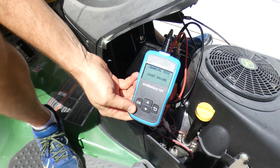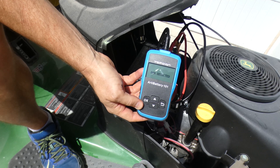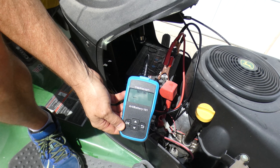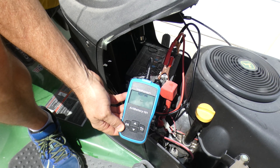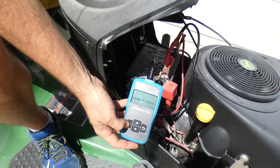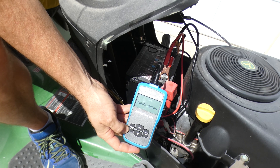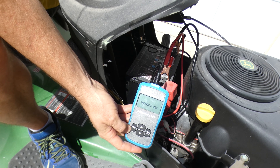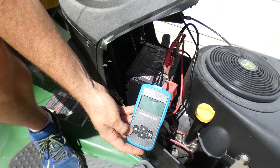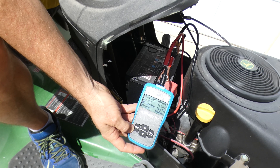I did test it on my third vehicle which tested fine, but seeing good results isn't very video worthy, so I chose to only show the two where it actually found a bad battery. We started the lawnmower as well. Most lawnmowers don't use alternators — they charge the battery using a stator instead, and you can test those just fine as well. The starting test worked out fine, nothing wrong with the starter on the lawnmower, just a bad battery. The charging system came back just fine. It's just the battery that's bad — I could replace it, but I'll just keep charging it since I don't use it very often.